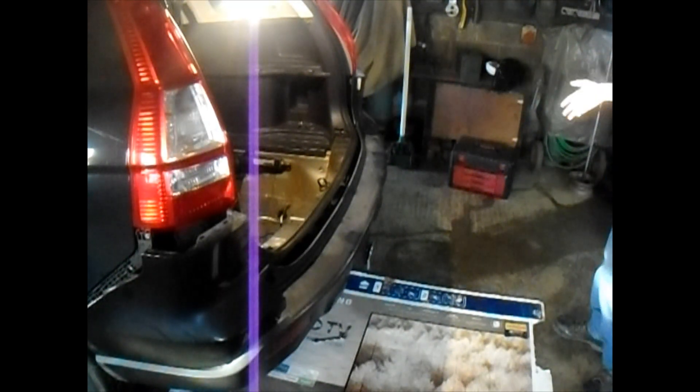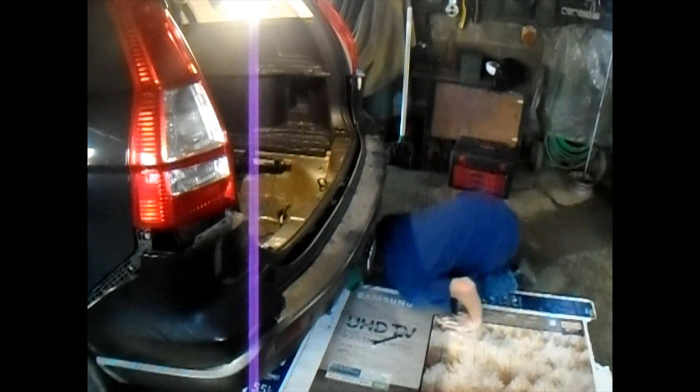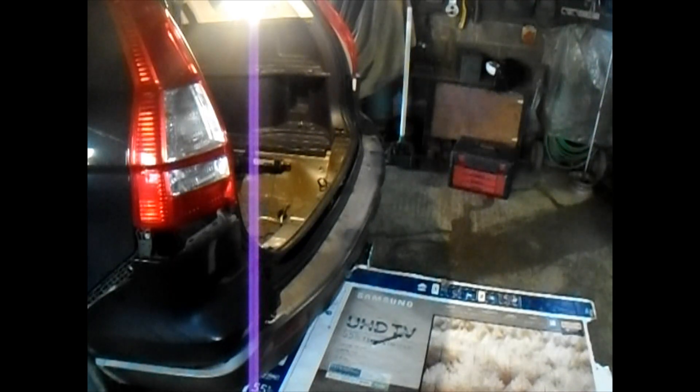Mine has a hitch, so you want to grab right here in the middle, or you can get a buddy to help you. I've got it up on the tripod and I'm going to try to pull this rear bumper off myself. There are some two clips underneath — I've already pulled those. Along the bottom here there are several clips where your body panel pliers will come into play.